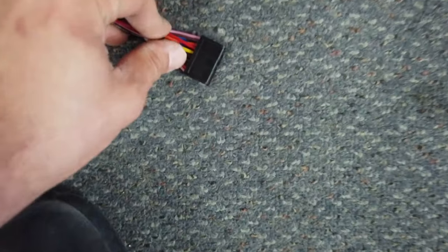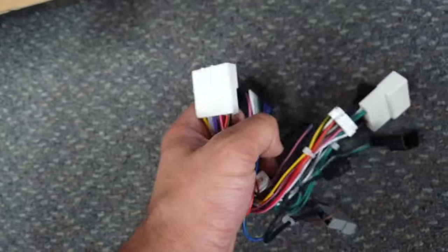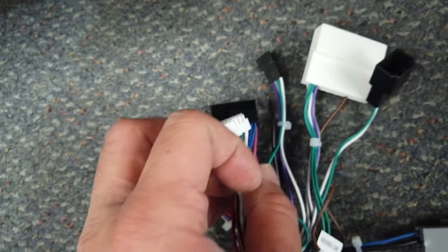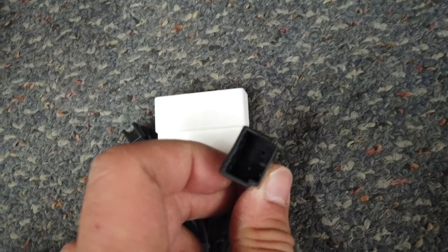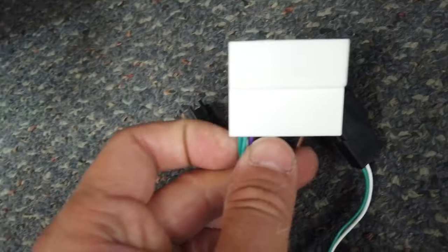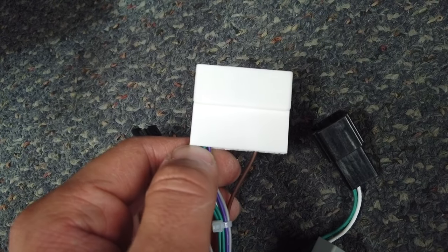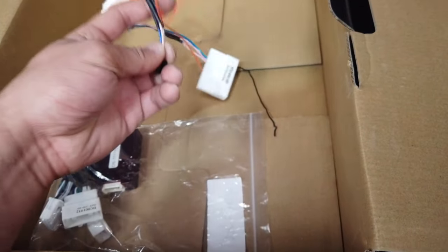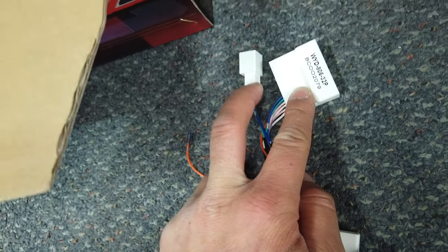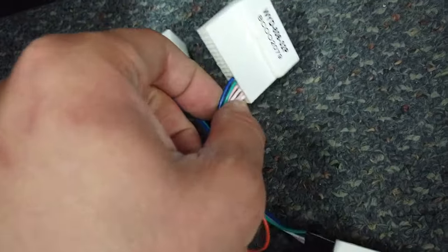This is the main harness. This black connector here goes to the Tesla unit. This goes to every single 370Z — this is the power and speaker harness. This goes to the bottom section of the Tesla unit for the aircon and volume controls. This here is optional depending on your model — it goes to the factory aircon box only if your model has a black connector underneath the aircon box. This will need to be used as well for your speakers. If your model is Australian 2009 to 2011, you'll need to use this extender connector. Connect the black connector to your 2009 to 2011 Australian model — it gets extended, duplicated and realigned for your model specifically.